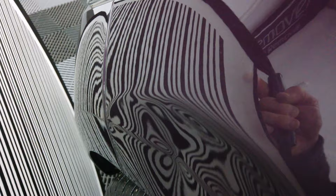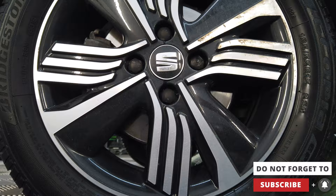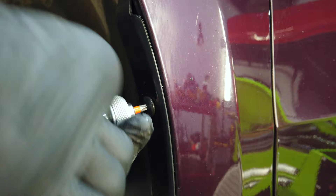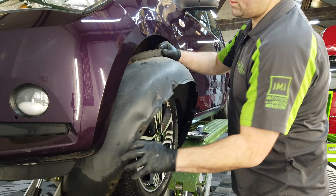So that's a quick explanation of the damage. We now need to lift up the vehicle and remove a few trims so we can get access to the rear of the panel. On a large scale repair like this, I want to be able to work freely from the underside without any obstruction. Luckily most front wings come with plastic liners and these are easy to take out — just a handful of screws and clips, give them a wiggle and they come out.